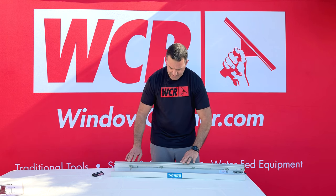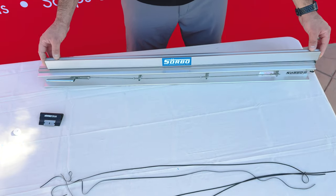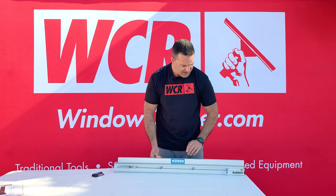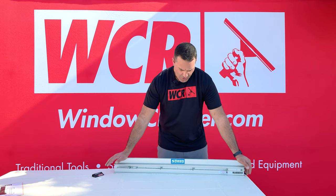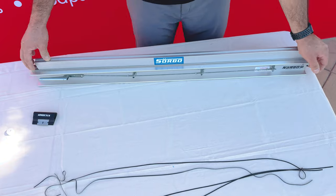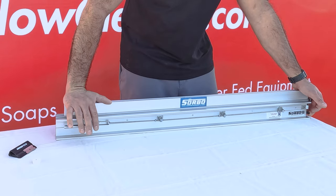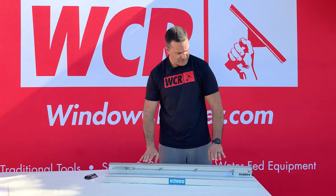Once the rubber is in place, clamp the docket closed. Then take the top guide, put it right on top — make sure the Sorbo logo is facing outward and it is not upside down. Using the palms of your hands, gently but firmly hold the docket down in place. Your left hand is going to be on the trigger of the lifter, holding it firmly up while you open and close. After it's closed, let go of the lifter and make sure it's nice and even completely across the rubber blade.